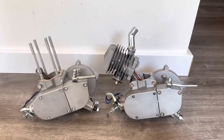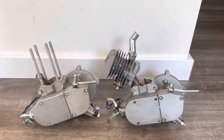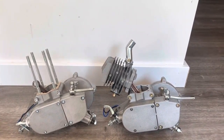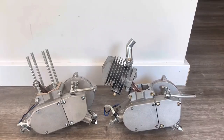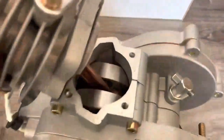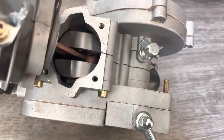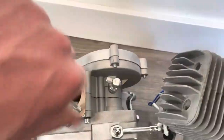When these engines were first introduced they used 6 millimeter bolts to secure the cylinder. However, many people were having problems with the cylinder studs stripping out, so they switched to 8 millimeter in later engine models. However, due to recent cost-saving measures, I've seen them revert back to the 6 millimeter stud, which is disappointing. If you look here, you'll see they only have 6 millimeter holes and screws, but if you look at the Wildcat you can see these much bigger 8 millimeter studs.